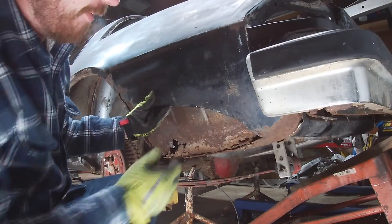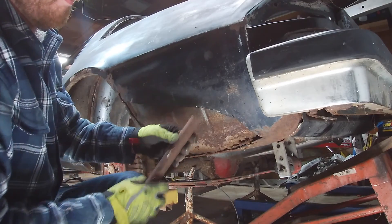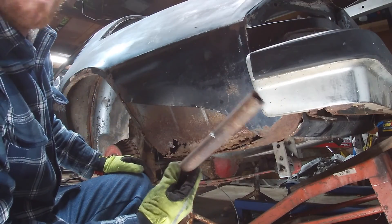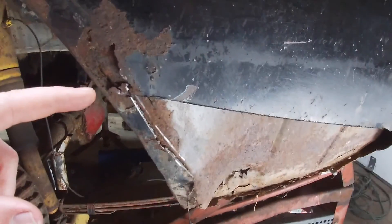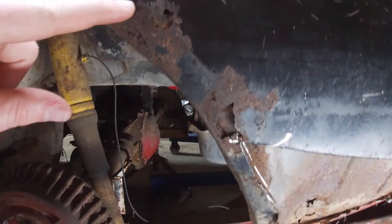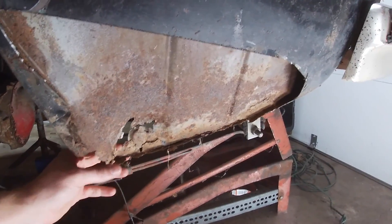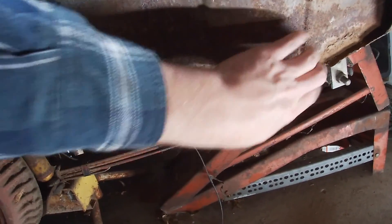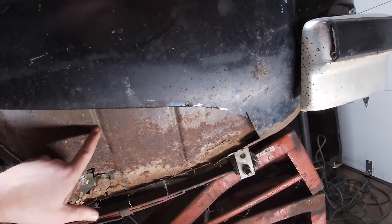Guys, look what we found up in here. This just came out whenever I was cutting. Oh my gosh. Look at that — it is just like a steel pipe just sitting up in the drop pan. So we got this section cut out. We do have some damage still here that we've got to cut out and check, because I want to make sure we get all of the damage out. It is still really rusty and we will have to replace this drop pan, which we already knew. Down here it's completely rusted out. It's got some pretty bad surface rust as well. But as it comes around this back, it's mainly just surface rust, so really it's just a section with the drop pan.